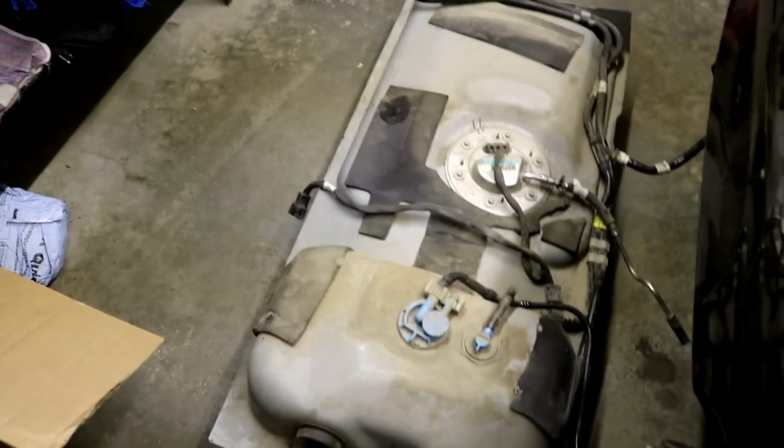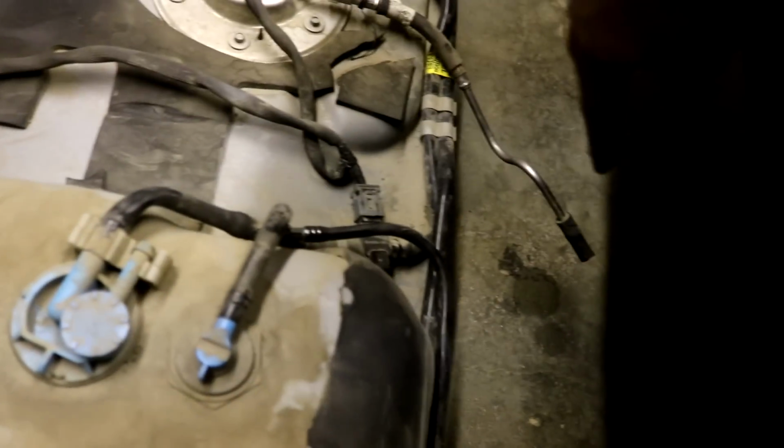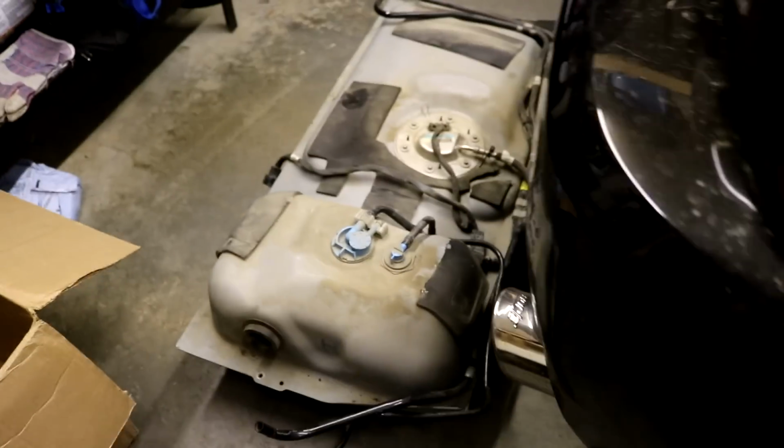Step 3. Remove fuel tank. Whoa, okay, remove fuel tank. So instead of doing that as step 1, it is now step 4. We pulled the tank out, it was really uneventful. We didn't have the factory Ford disconnect tool, so we just cut the rubber line since it's getting replaced anyways, and it's full of fuel.